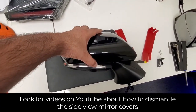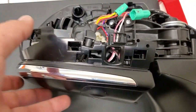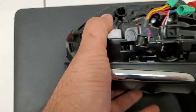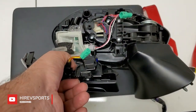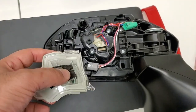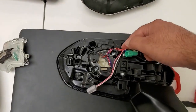When you remove the plastic cover, you have to disconnect this green wire. For the XSE, you also need to remove the pink and white wire connected all the way inside for the LED light. You need to remove this 360 camera — it's not fun to remove, so be careful. Don't break this cover. I've already disconnected it.